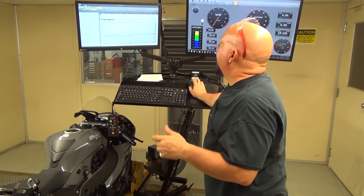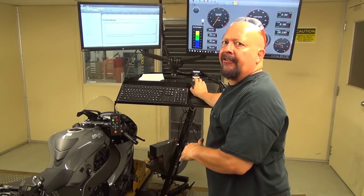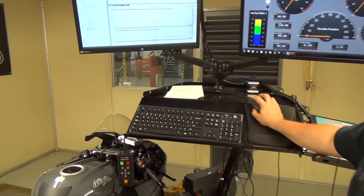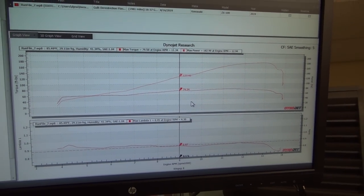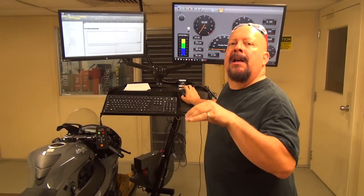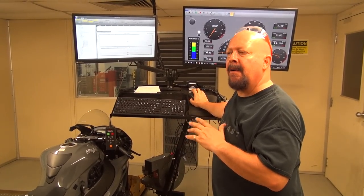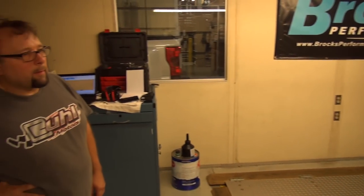All right, guys, so what we've done here, I've actually switched our scale over from air fuel ratio to lambda. And what we've got, our lambda reference line is 0.88. And then what I'm going through here now, and I'm giving Don a reference lambda number at specific RPMs because it's easier to tune in lambda. Some people find it easier in air fuel ratio, but Don, can you just maybe give a quick glance as to why lambda works out better for what we're doing here?